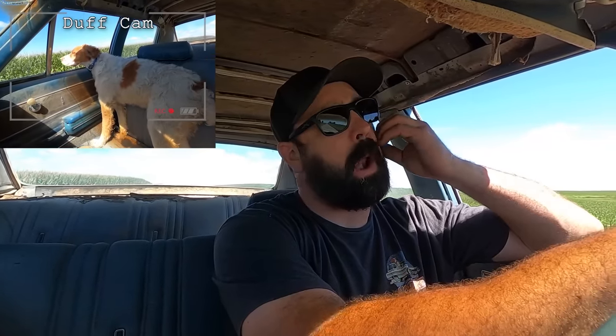If you got a FE or a small block Chevy and it's got a cast iron intake and a two barrel, leave it. Spend your money somewhere else. Don't buy that aluminum intake and new carburetor, and then you're messing with linkage and air cleaners never match up. Just leave it bone stock under the hood. There is nothing wrong with a two barrel. They're freaking awesome when they work, and they're easy to work on, and it's a great way to learn if you don't know how to work on them. So rant over. Stick with a two barrel. You approve, right, Duff? Two barrels where it's at.